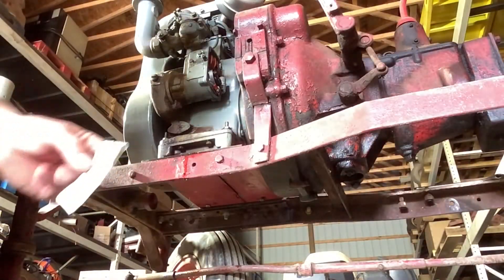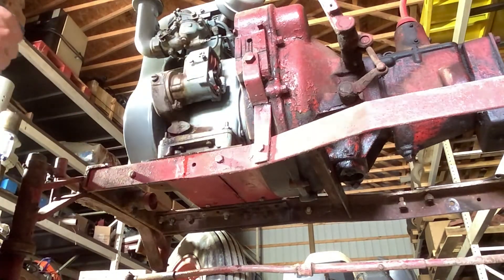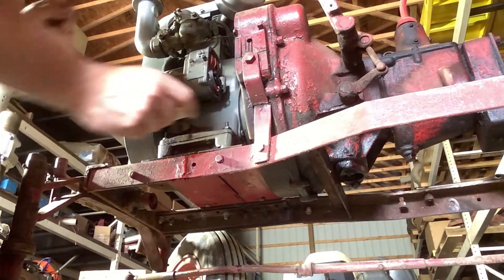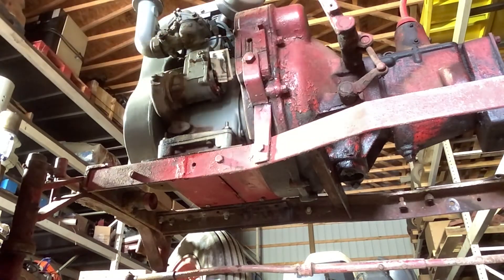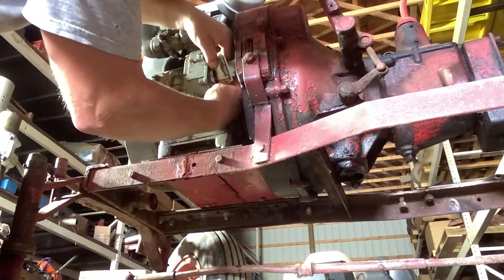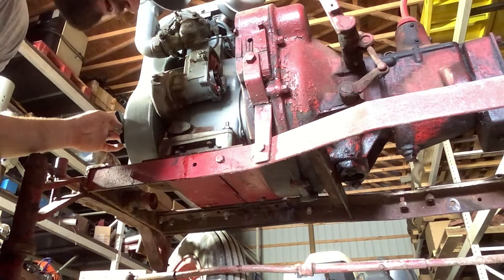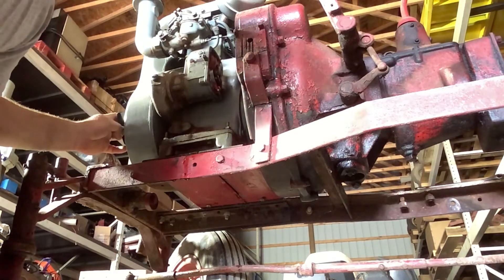I've mentioned this before, but I'm just going to use a dollar bill, fold it up a couple times, and use that to polish my points. Reason being, it's not a great idea to use sandpaper and scratch those points — I'd rather just polish them and clean any debris off them. So I'm going to push that open, get it in there so it's just held in place, and wiggle it back and forth — that should be enough to clean those up. I also see, looking at the screen, that I've got a crack right here, so I might do a little repair welding on that just to make sure everything stays in place on road travel.